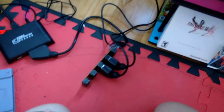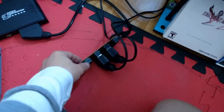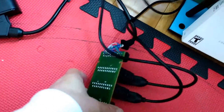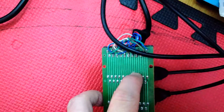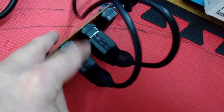We're trying this one more time. I'm not sure where the video cut off — I didn't intentionally cut it. We ran into some problems. So what we've got here: the Super Famicom is on the second port. What's significant about the second port is that it's completely connected — the power circuit is still intact, despite that scratch there, it does not go all the way through. The third port is disconnected at the power circuit, which is the Sega Genesis.